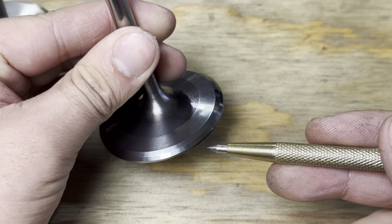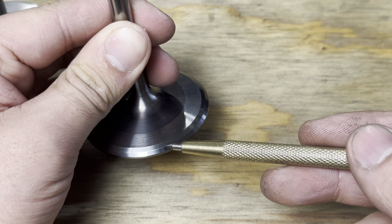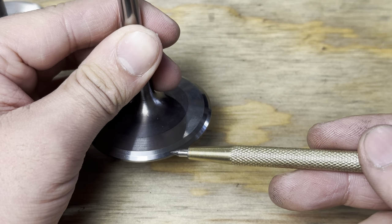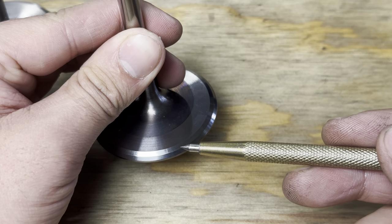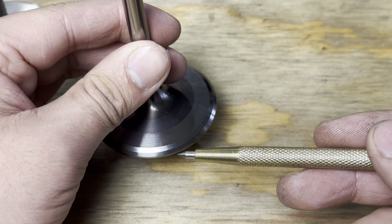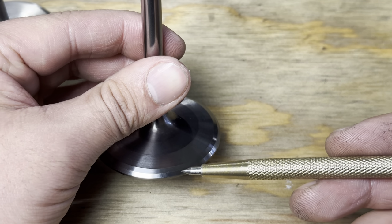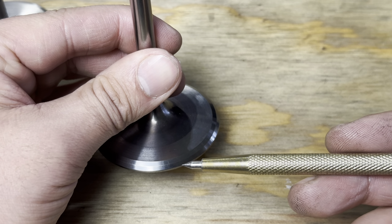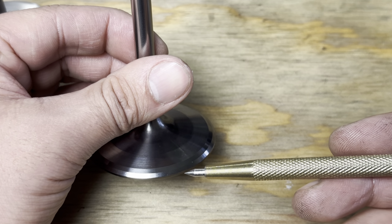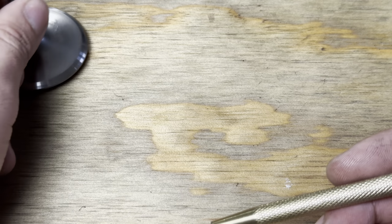Look for any blemishes. Another thing you want to look for is if you see the texture or the color of the valve face change. Titanium will be this light gray color, and then the CRN, in my opinion, is like this dark blue cobalt type of color. If you see that cobalt color go away, you're going to start scrutinizing the valve and wondering if that coating is worn away or if it's missing. Sometimes you'll even see that the coating's chipped away. If you see any flaws in the coating, you're either going to start thinking about replacing the valves or you'll have to regrind them and send them out to be coated.